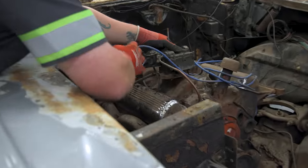We've got this axle right where we need it. I'm just putting some paint marker on it. We need to go off site and weld these perches on, but the problem is it's after five so we won't be able to weld these until tomorrow morning. Luckily we've got the entire fuel tank in and done, we've got the rear end, the leaf springs are in, the rear housing is set, the front spindles, upper control arms, and lower control arms are where they need to be.